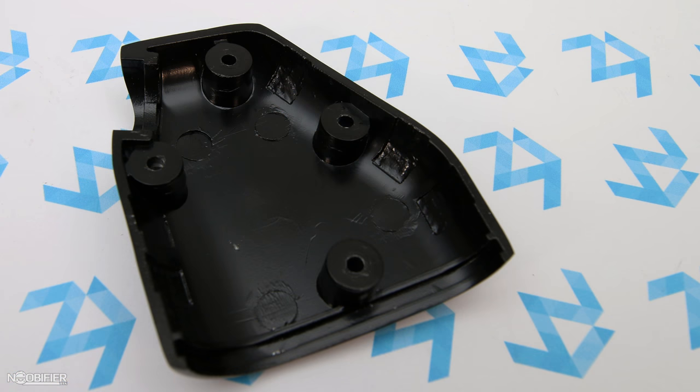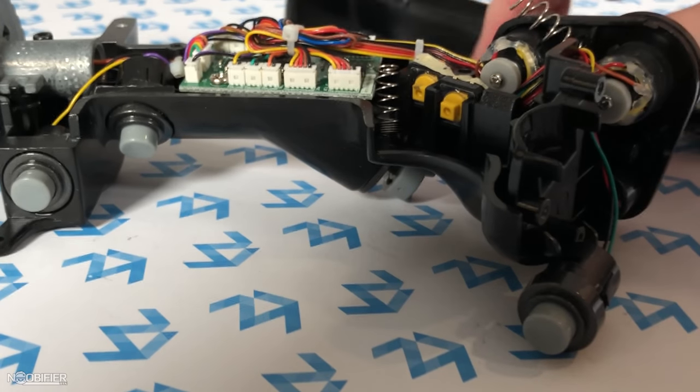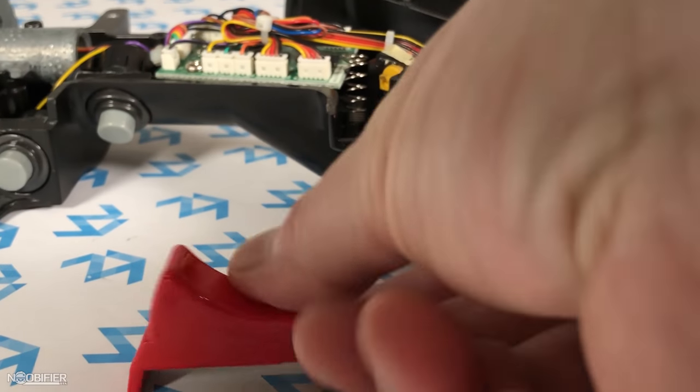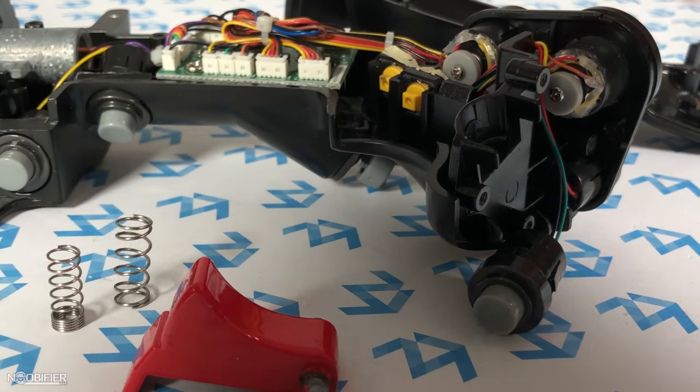The casting is very nice and of very high quality. Steel bolts screw into aluminum, which means there's a risk of galvanic corrosion — if your house is humid, steel and aluminum will eventually bond. However, my grip is five years old and when I opened it the bonding was very minor. This could be prevented by reassembling with blue thread lock or a very light oil on the bolt.